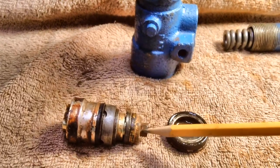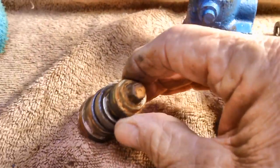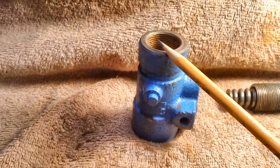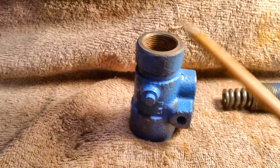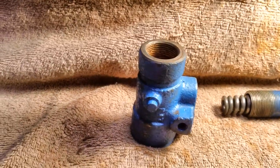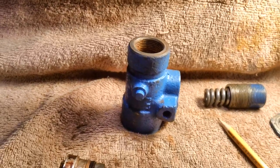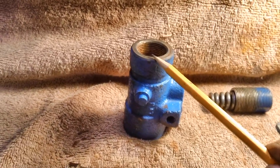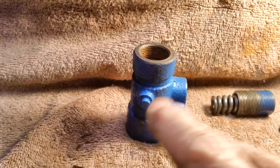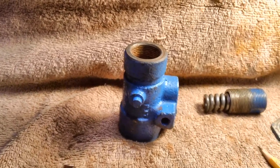Now I could fiddle around, you know, de-rusting this thing here and scraping out some of the rust around that bolt head. It's quite a bit. I could get it loose, but there's no sense in going through any of this until I find out whether the inside of the proportioning valve case is shiny and clean. If it's all pitted and messed up, we can stop right here, and then we'll just go ahead and order a new proportioning valve through Summit Racing, I believe it is. Yeah, Summit Racing. I think it's called a Stillwell or Sitwell or something like that. Proportioning valve. We'll get one of those.